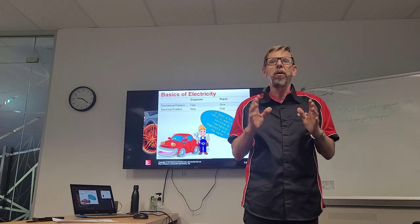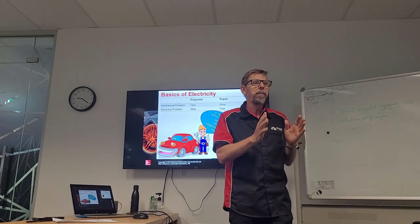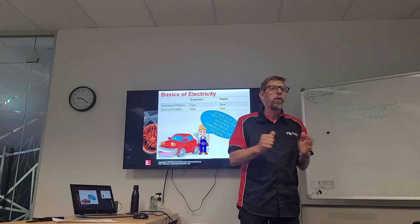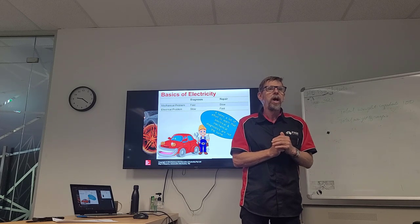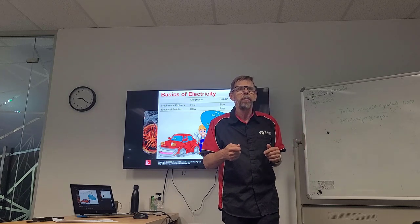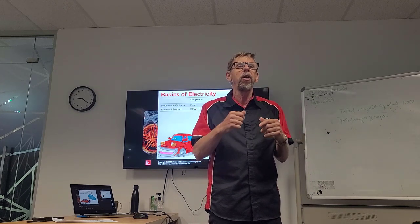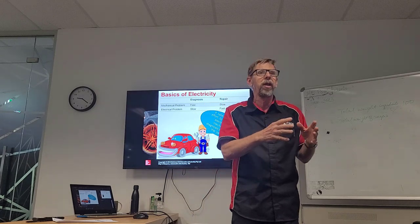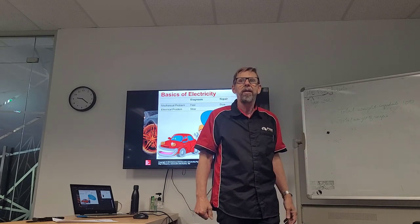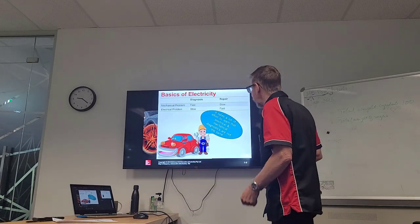Guys, if you want to do a job properly, the time we spend at the beginning of this job is going to save time in the long run if we put the right time into fixing something. If we go just changing a component in an electrical circuit because it's not working, it might not be that component. It's very likely not that component. It's very likely a wiring problem or another sort of circuit problem, okay? So we need to keep that in mind.